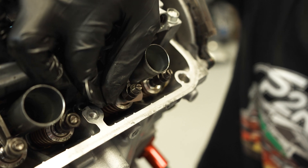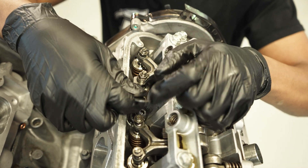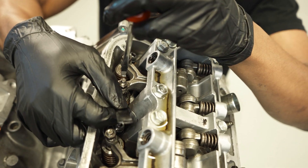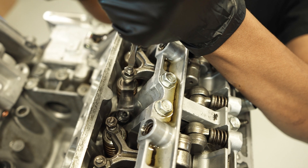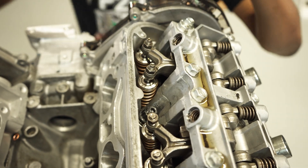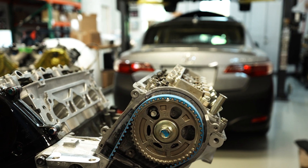Sometimes when you tighten, that screw can turn on you — in this case I wasn't that happy with one of my intake sides so I'm going to repeat the process. I actually did this one on purpose to show you that double checking is key; you want to do it over and over until you get this right. A lot of people think it's a science doing the valve adjustment, but it really comes down to spending the time and doing it properly. Also with the feeler gauge, sometimes you feel like you're hung up in there — it feels tighter than it truly is because the feeler gauge can be getting stuck or wedged in at the wrong angle. So I rotate the angle to make sure I'm sliding on a smooth enough path to get the proper feel. I torqued this one and the feeler gauge now feels exactly where I want it to be.